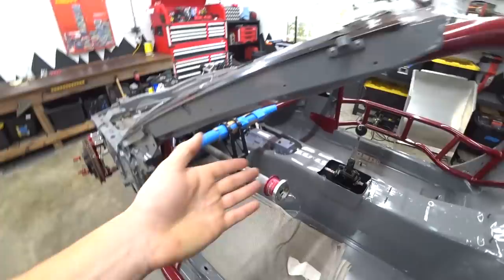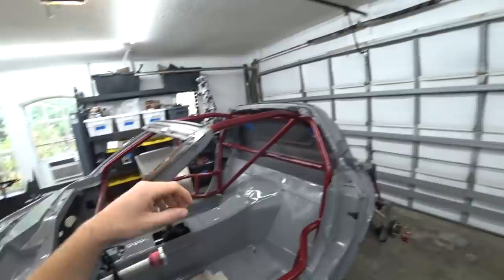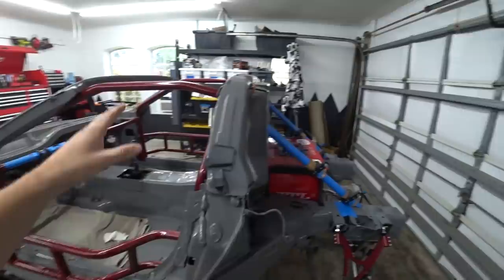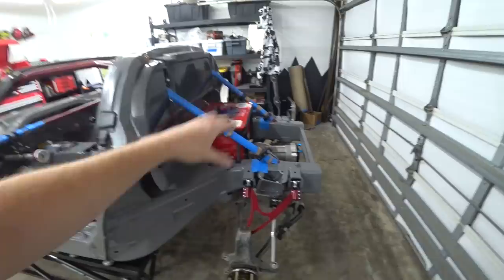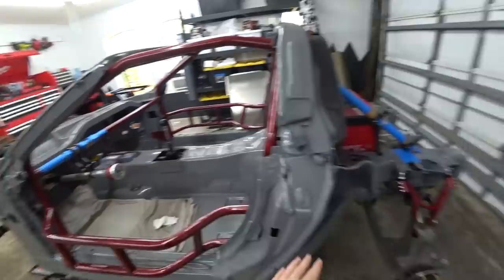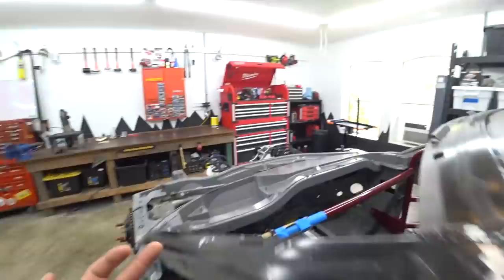If you're not familiar with this setup, basically normally in a Vette the transmission is in the back right in front of the diff. We went ahead and put a race transmission up here in the front. There are a few reasons for that — this is a much more affordable transmission option, and it's much more serviceable. With the rear transmission setup, if you want to do anything with the clutch, clutch hydraulics, the trans, the diff — any one of those things — you have to drop the whole rear subframe with the transmission, differential, and torque tube attached. For us, we're a small group, and with this setup we can pull the transmission at the track in a matter of 20-30 minutes. It's really just a matter of getting the exhaust out of the way, dropping the trans mount, four bolts, and boom — this thing comes out.